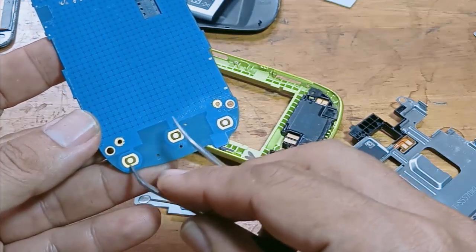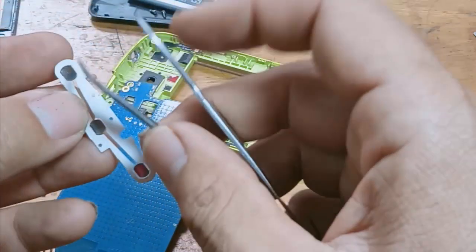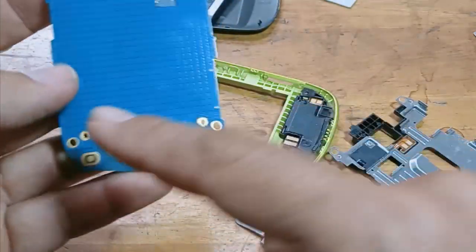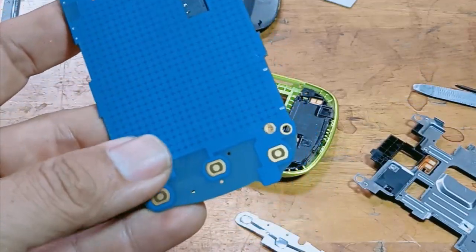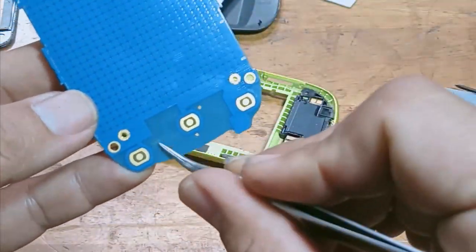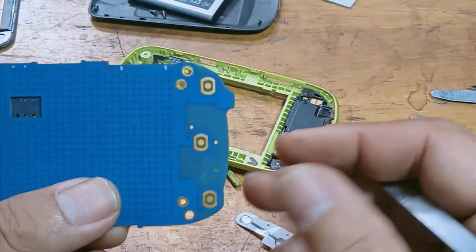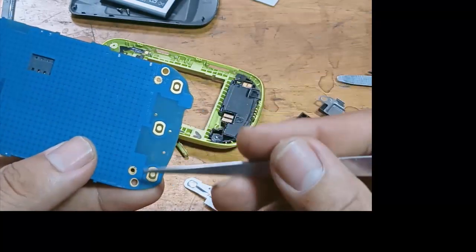Here I will clean the rows and columns of the keypad. This is the key cup — when you press a button, the key cup makes contact. These are the row and column legs. The two copper pads make contact with each other, and from that the CPU knows which key you are acting on. Using a blade or a rubber eraser, scrape and rub the contact area here and the two copper sides of the key.